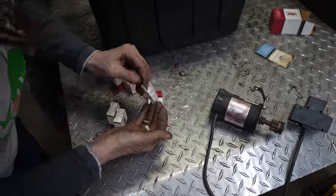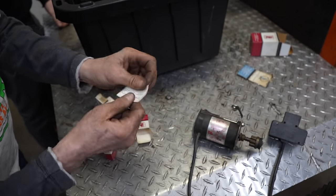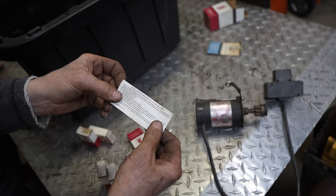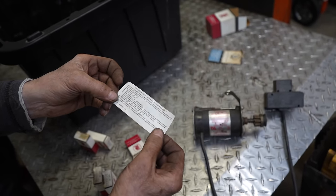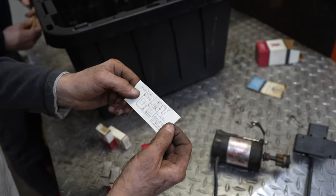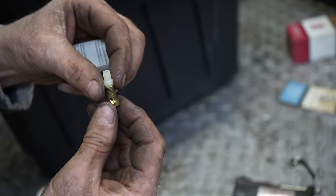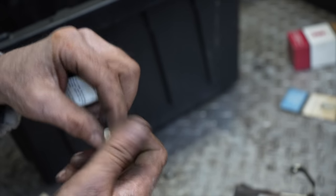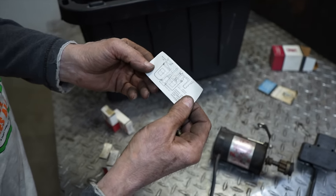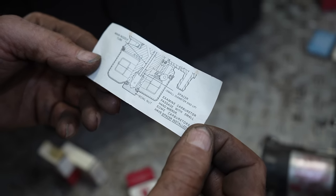Something with a love note — it's a plastic thing with a bowl nut which is the main jet. Instructions for installing a high-altitude bowl nut kit — for engines operating above 4,000 feet elevation. There's a kit where you put a little sleeve up over the main nozzle in the carburetor and then install this bowl nut. Not sure where you'd use this unless you're in Colorado or somewhere at high altitude. Small diameter end goes up.